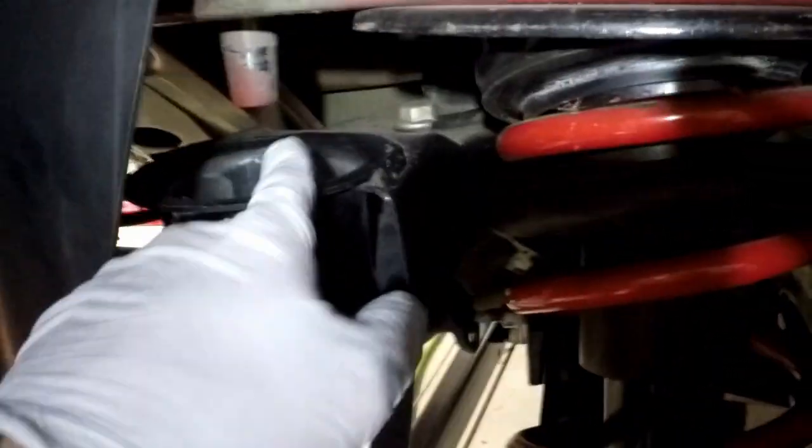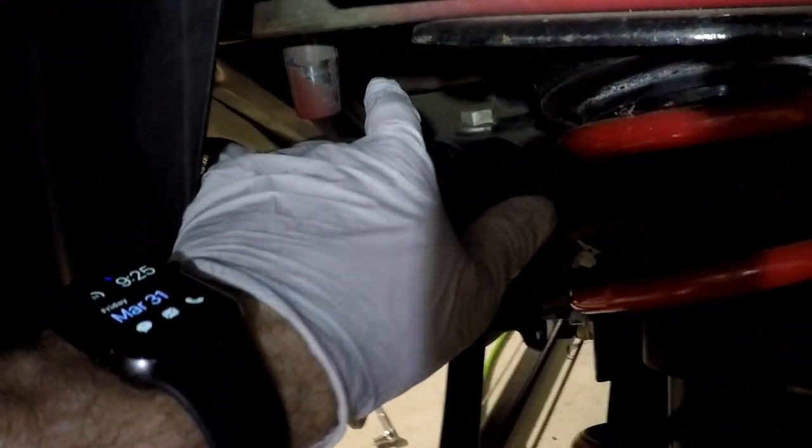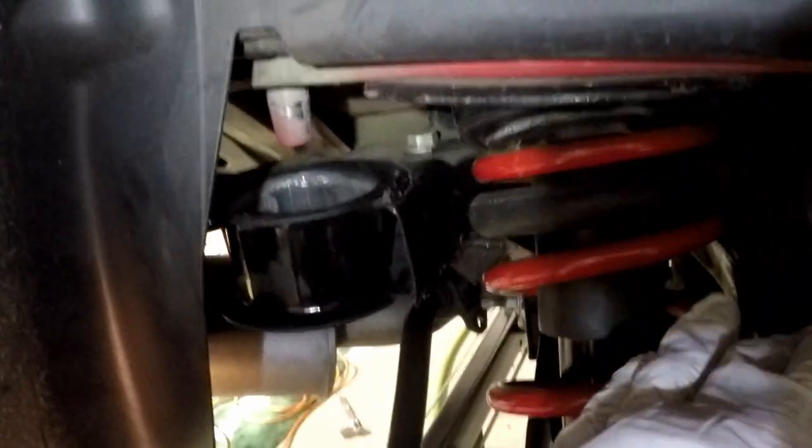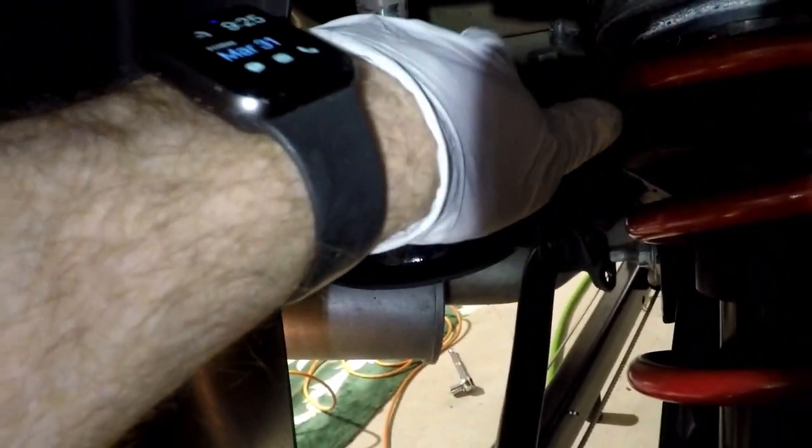So another quick thing on putting anti-seize in here. Make sure it's cool enough that you can touch it. Otherwise, the anti-seize is going to liquefy and just run all over the place. It's another reason why I wipe most of it out with a paper towel. You can see,